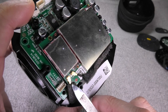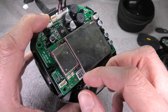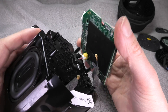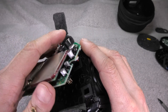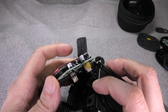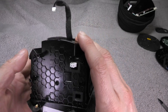We have to be careful when removing the motherboard because there is a small connector underneath, and also the two antenna connections to detach first. After detaching those, I carefully start to lift the board. Near the speaker connector there are six open pins that go down into the rest of the speaker housing. I now carefully disconnect the speaker.